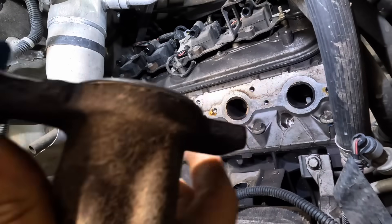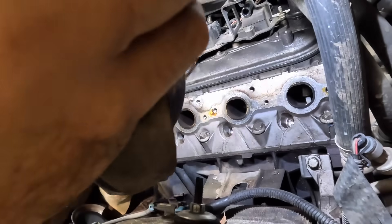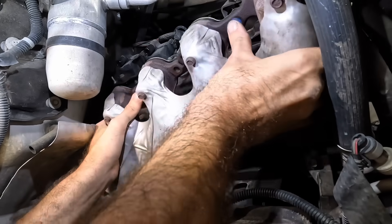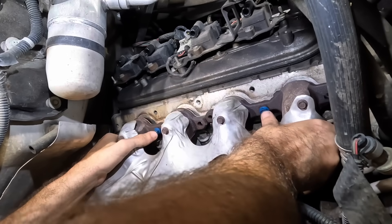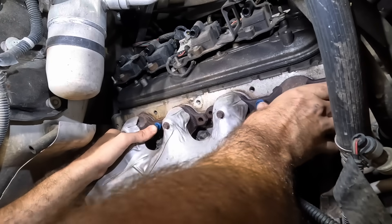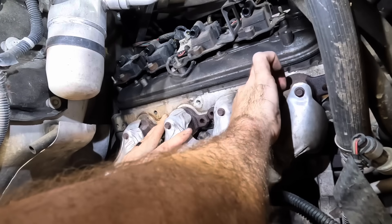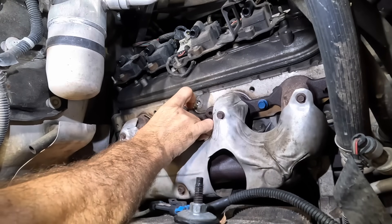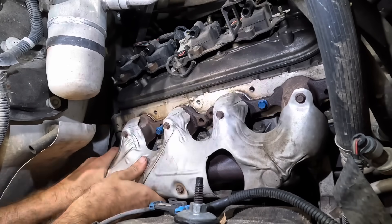Manifold is on its way in. Got the gasket set up on it and I've got one stud in right here and then another stud. There's two studs just hanging on to the gasket and I just need to slip this thing into position and get these two bolts started just a little bit. There's another method in case this doesn't work — if I can't keep it all aligned, we can just get one bolt in and then maneuver the other side once the weight is taken up by the first bolt. Which is exactly how this is going to have to go here.